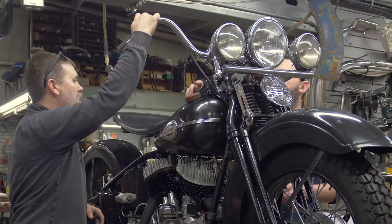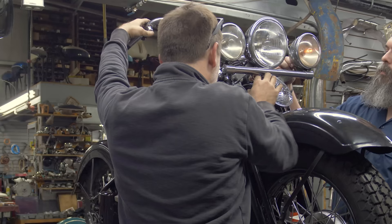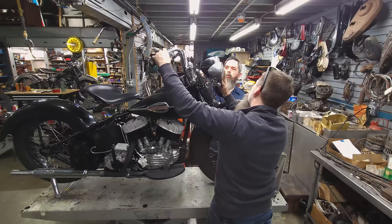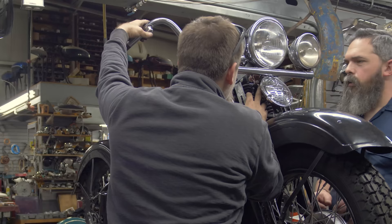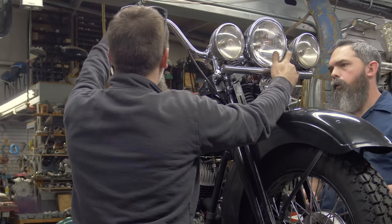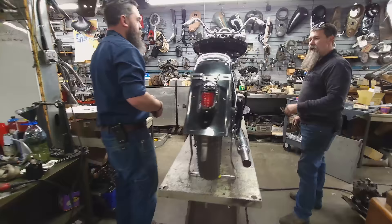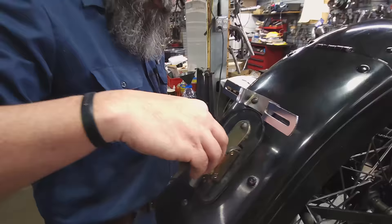You want to do the key? Nice loud horn. Got a headlight. We had it together. It may be a ground issue — touch this to it. Yeah, you got a jump wire? I'll just get the screwdriver. Wiggle it. So we don't have a ground. Tail light — dim as all get out but there is a change. I wonder if that's a 12-volt bulb in there. I don't think we changed it. So we will want to fix that with a 6-volt, two-filament — I think it's an 1154 bulb. We have a ground on the headlight. Let's just do it now so we don't have to take it back apart.